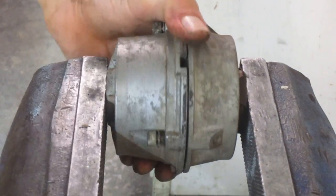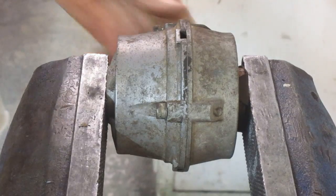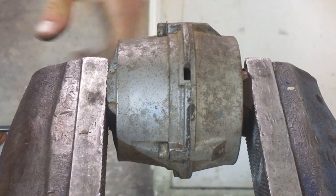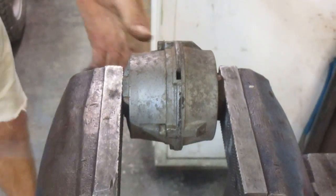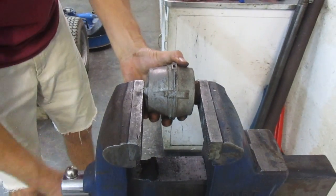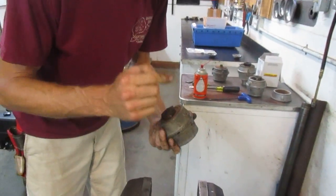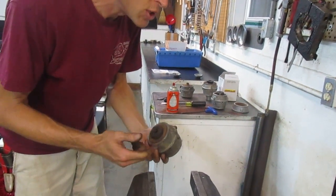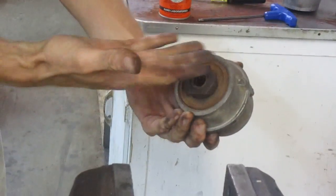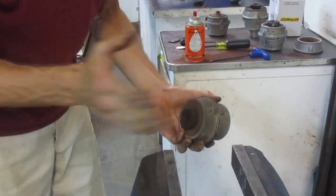There are two main failures with clutches. One is the machine not stopping fully when you squeeze the clutch — what we call clutch dragging, where the clutch is transferring power when it shouldn't be. That is usually either a cable adjustment issue with too much slack in the cable, or if you've tried adjusting the clutch cable and that didn't solve it, it's one of those two bearings that's bad. From experience, the inner clutch bearing goes bad 80% of the time rather than the outer — which is a problem because you have to take the clutch apart to get to the inner bearing. Because of the heat the inner bearing is subjected to, it typically fails first. When we rebuild the clutch, we always put both bearings in — it's not worth fooling around as long as you've got it apart.